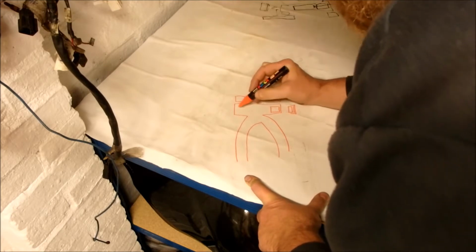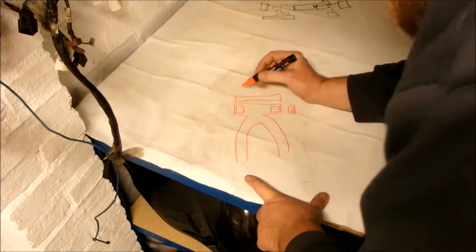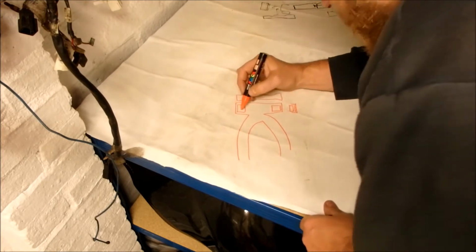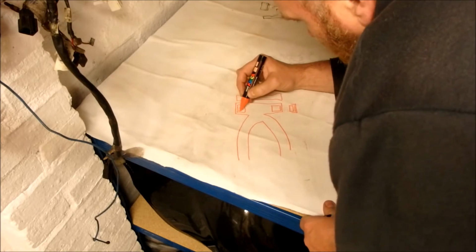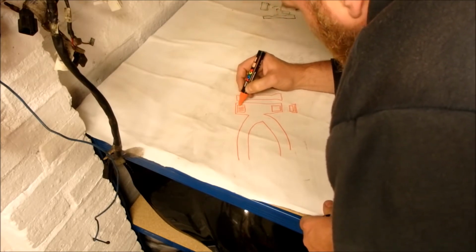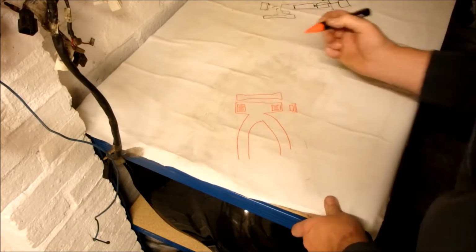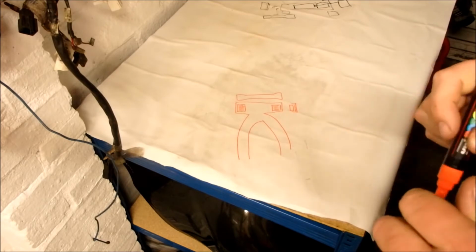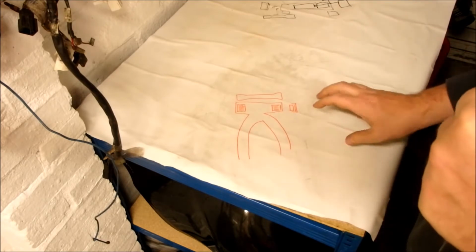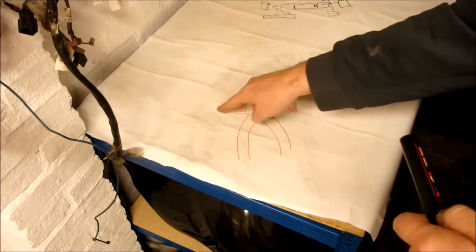These are needle bearings. Needle bearings are slightly different from the wheel bearings that we've already seen, in as much as they are much longer. Instead of having ball bearings in, they have small rollers shaped like that, which make them very difficult to get out in one piece. But they tend to be a lot more delicate than the round ball bearing type bearings that we've seen in the past. And there's a cap on the other side.